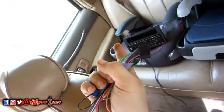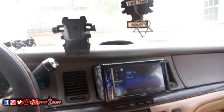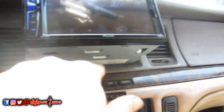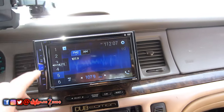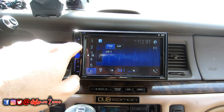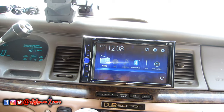Alright, so I never expected this — the same harness that came with the Kenwood actually fit the Pioneer, because I didn't even have to do anything with the wiring. It's the same connector. I just plugged it right into the back of this and it started working. But there's some plastic around the dashboard that has hindered me from pushing this thing all the way down and in. So I'm going to have to take something and cut that to be able to push this back into the dash. But the way that it sits, it's actually working. This is turning out to be more simple than I was expecting. So this is cool.